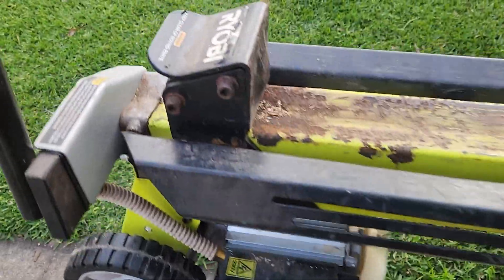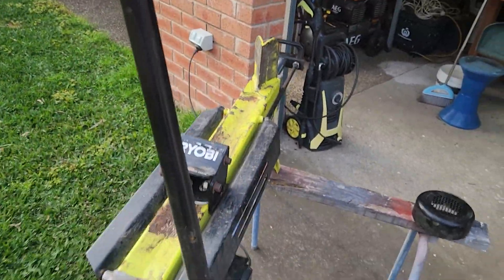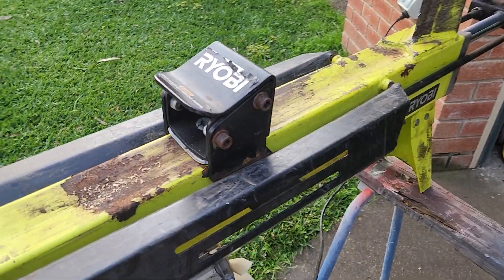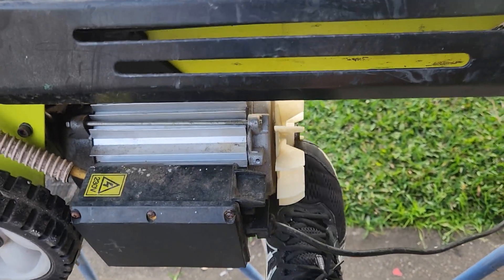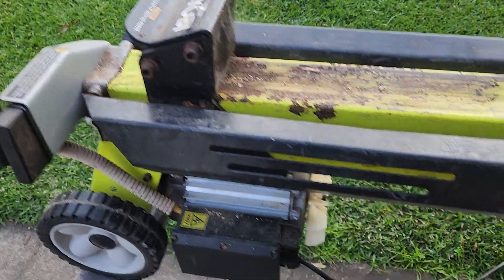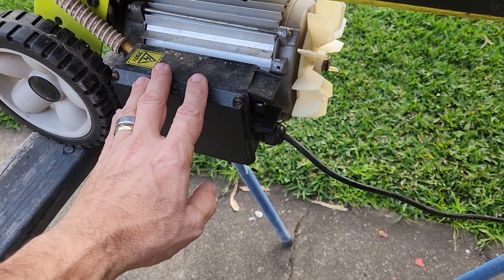The way this works is it stops, and when I pull it over this way it continues moving. I'll turn it off and switch it the other way and it retracts. It will go back all the way but it probably will not turn on again. I turn on the switch — no, I literally have to push the fan manually every time. So there's something with the starting ability of this motor. Let's open this up — I've got a feeling what it is.